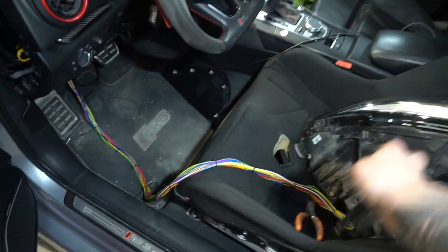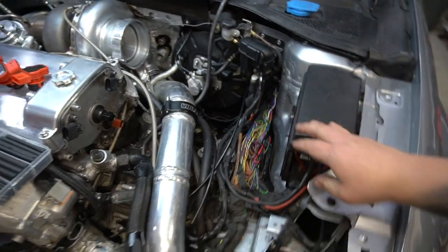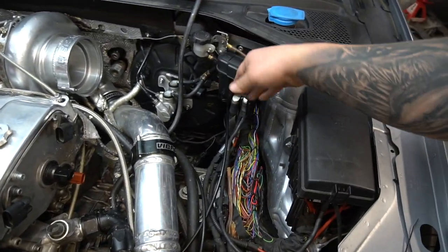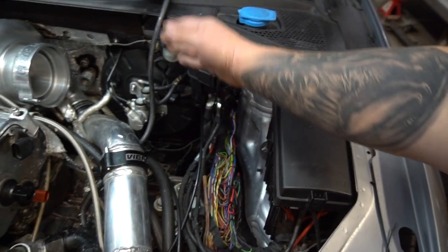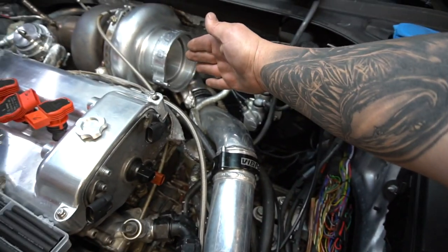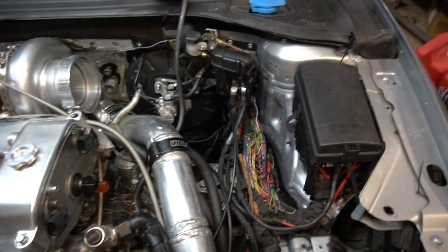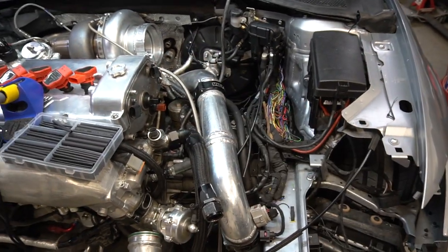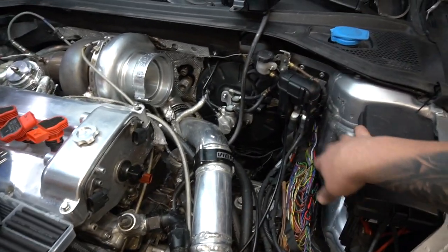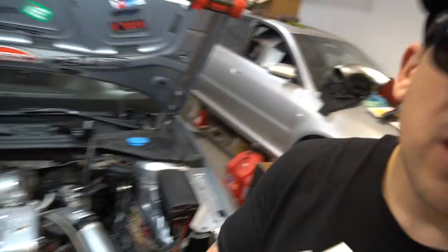This is one of the bigger tasks and it saves a lot of room in the engine bay. The S7 ECU was previously only about 14 inches away from the tubular manifold, which gets up to about 1,300 degrees on wide open throttle. Moving it frees up space and keeps it away from heat. George will be changing a lot of stuff — we need as much room as possible for a big catch can, maybe a nitrous solenoid. It really frees up a lot of space.